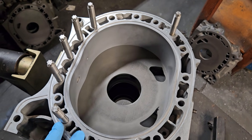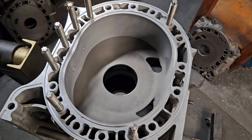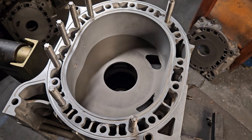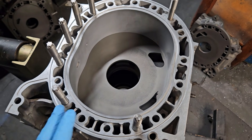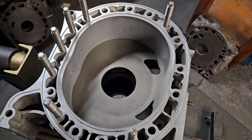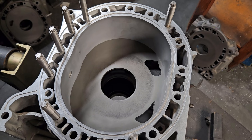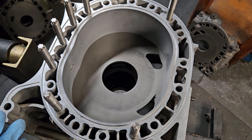You've got some options. Obviously, if you're trying to really push a lot of PSI, a lot of horsepower, fully studding the block is the way to go. But in a lot of cases, especially with RX-8s, people just want a mild performance upgrade — just a little turbo. A little boost goes a long way with most rotary engines.